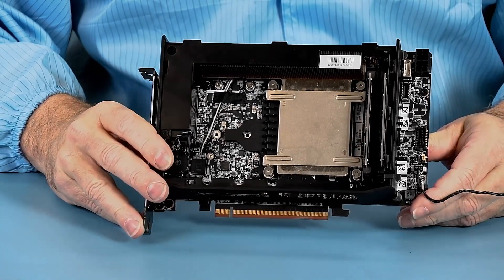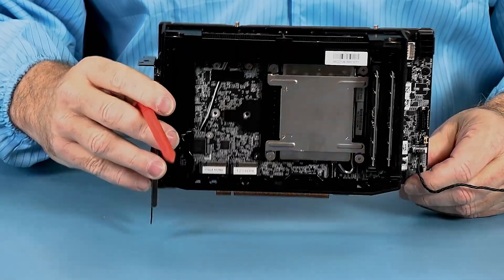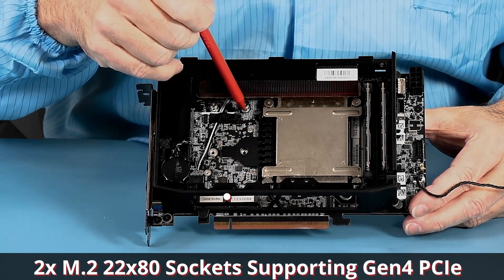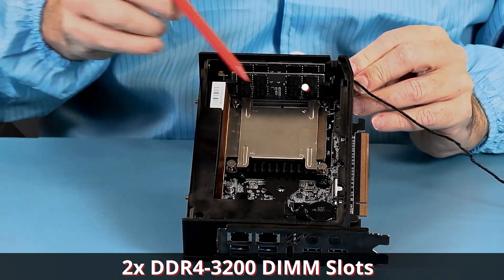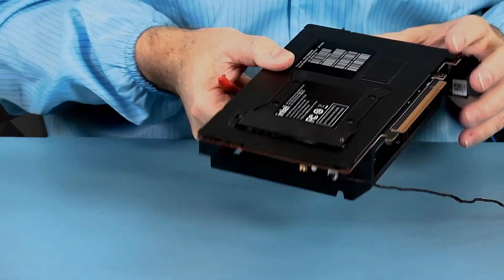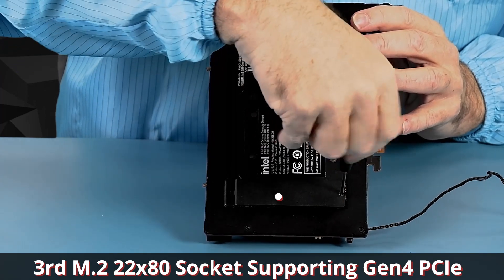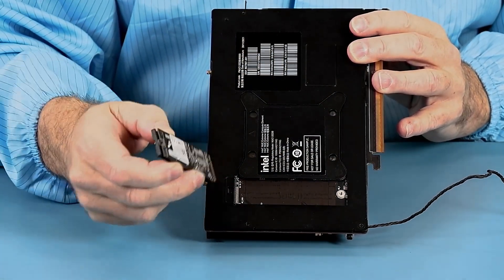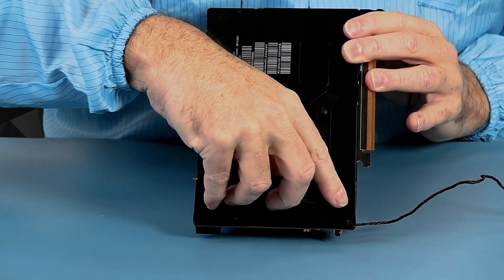Let's take a closer look at the Eden Bay itself. Here is the processor under this large heat sink, which brings the heat up to the cooling fins you can see through all of the grills. Over here are the two 2280 SSDs and the two DDR4-3200 DIMM slots. The time-of-day battery is also easy to access and replace. On the back side is the third 2280 SSD, accessed with a number-one screw — you angle it up and slide it out, and the SSD is attached to the cooling plate.